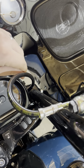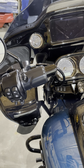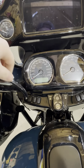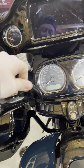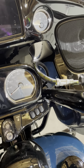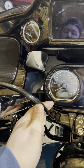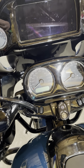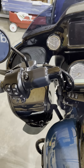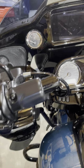These are the regular stock lines for your brake and clutch. I have a 2021 so I have the cable clutch — and oh my god, you cannot bend these cables to save your life. The hydraulic lines are really pliable, but these are stiff. You can't just bend and manipulate them as easily, so when somebody with a hydraulic line says 'it's not that bad, it's easy to reroute' — no, it's not.